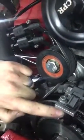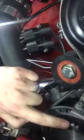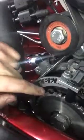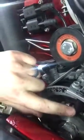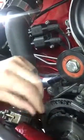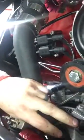So this sensor, this pickup, in relation to this trigger wheel is not very square. You can see it's kind of off-center. There's witness marks on the outside of this trigger wheel right here, like the sensor's been scraping on here. I did a real quick feeler gauge test and it was right at 20 thousandths, which is where it should be, but it looks like it's previously been rubbed on. You can see that its alignment isn't straight.